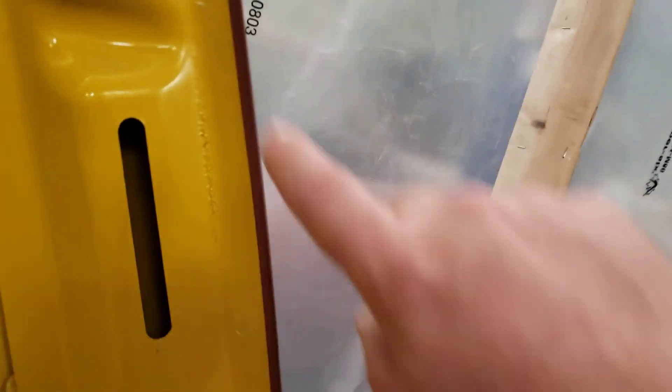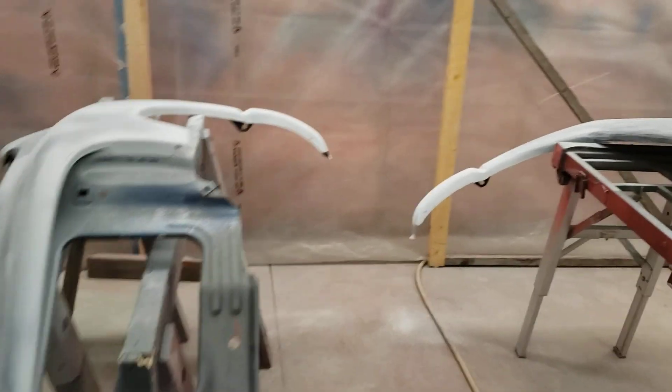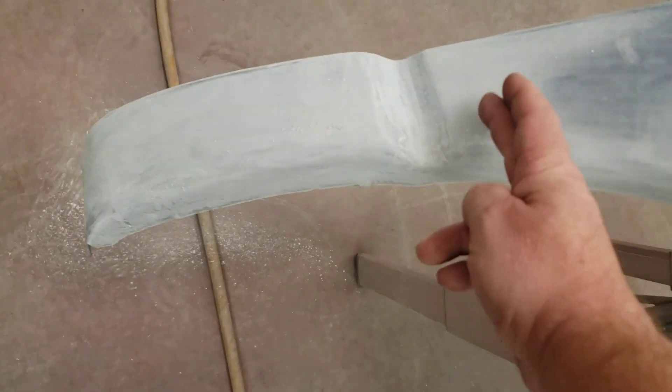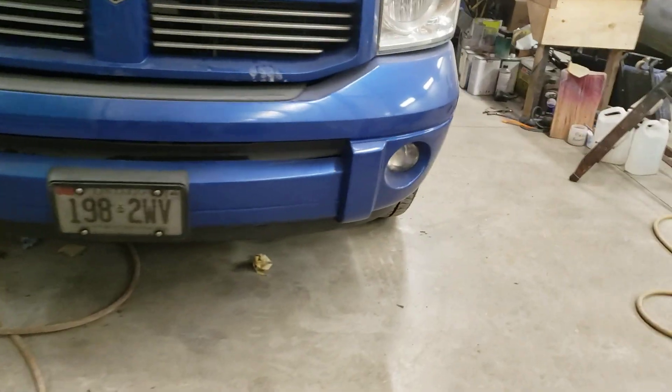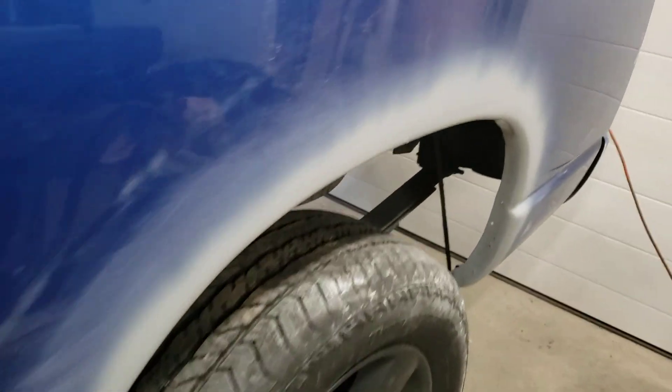Of course, the hood — I'm going to come in and basically just airbrush this little bit of red, make it yellow, let that dry. Then I'll set the hood down and paint the hood, the doors, the two fenders, and then we can put the Rumblebee back together. I did use epoxy primer from about here down on the dog legs of the fenders because they're notorious down there for doing things. I went ahead and put a couple real heavy coats of that primer on and then sanded it smooth, just to protect it and make it last longer. It's amazing — since I started using that primer I probably won't do much of anything else. I like that stuff.